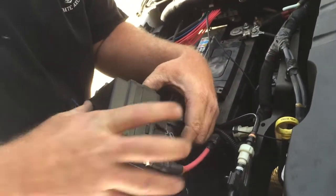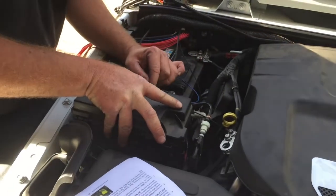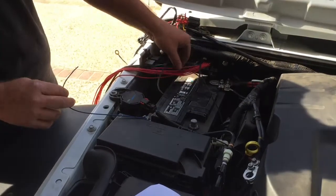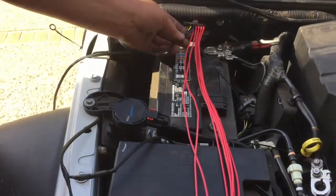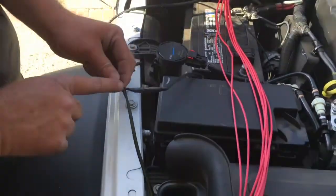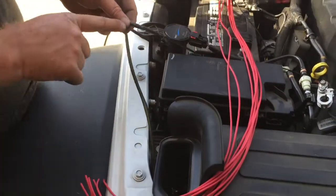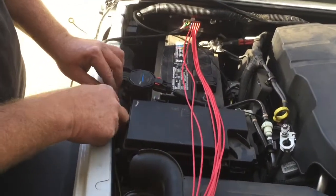Now I'm plugging this back into the bottom of the box, locking it back in place, and reinstalling it back down on the tabs until it locks in. There's our wire for our accessories. I ran the blue and yellow wire into a sleeve and ran the sleeve around and back along the side of the fender. I teed out the blue line with the supplied butt connector and connected it into the wire we had plugged into the C6 plug. The yellow wire we ran up and tied into the fender light, just like the instructions said.